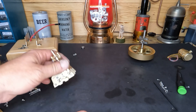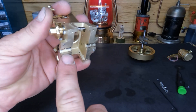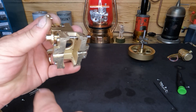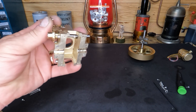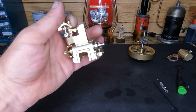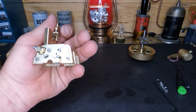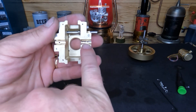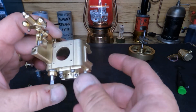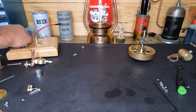You can see right here and right here — there's no oil getting through. It seems like an oversight because they've got ball bearings on the camshaft, which spins half as fast as the crank, but the crank is just steel on brass. Not having lubrication there is not a good idea. You can see right where the wear is — we drilled holes in there so we can oil it from the top side now and give it a fighting chance.